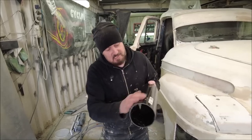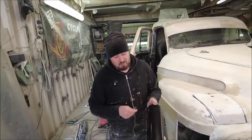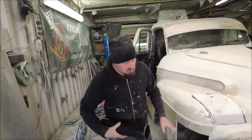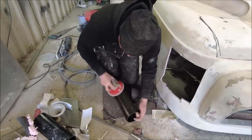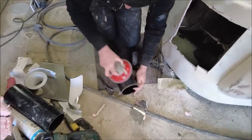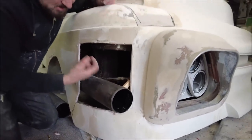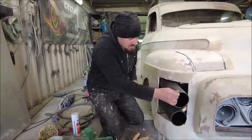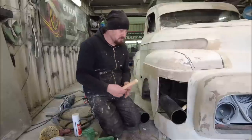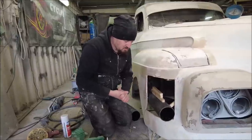I've offered this pipe up and it's looking about right. When you're doing any of this sort of work with plastic pipe, you need to DA it off so it's got some grip, because nothing will stick to this surface - it's just so slick and shiny with a sort of greasy feel. So I'm going to DA all this off before I mount it in. I've got it leveled in with a little block of wood glued under there and a screw in the back - it's not strong but it's holding. I want the other tube to sit about there, so I've got these bits of wood to drop on and glue to the top, then make sure they're held in the right position before moving on to the next stage.